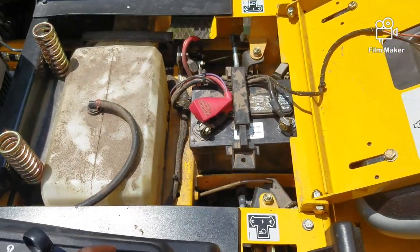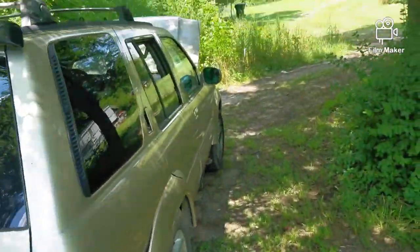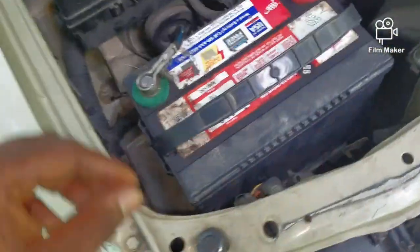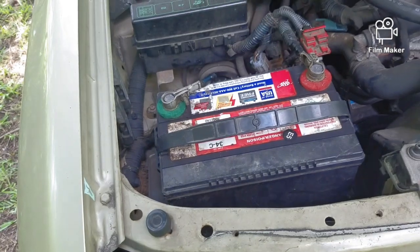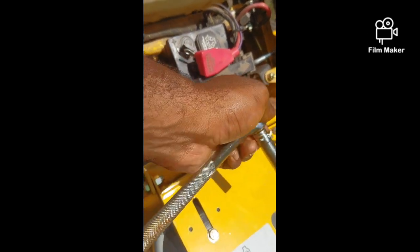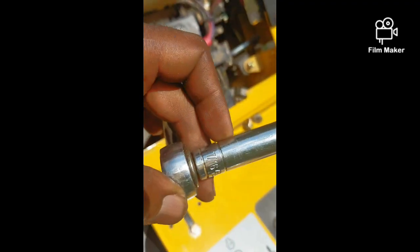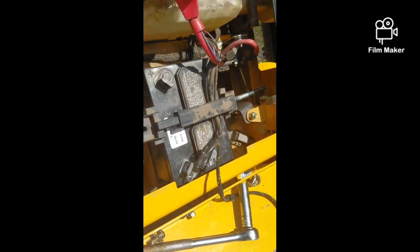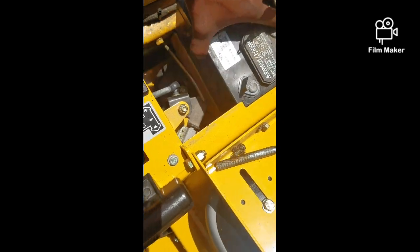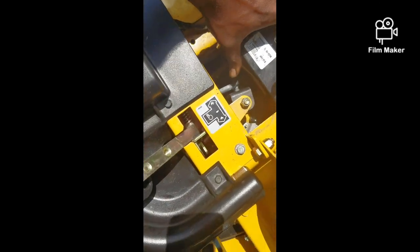What we have here is I've gone ahead and removed the strap securing the battery, and over by the truck I've already loosened up the terminal, which was already pretty loose. So on your vehicle you just remove the terminal. I used a 7/16 wrench to remove the terminal on the lawnmower as well — yours may be a different size. Try not to let the terminals touch while you're removing them. It's pretty simple, anybody can do it.